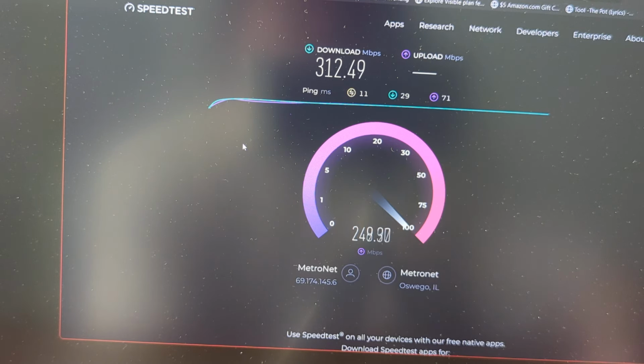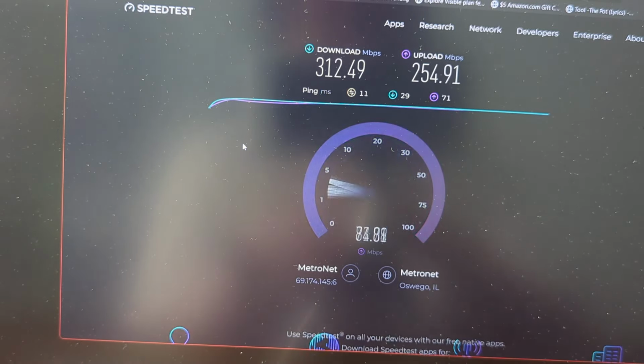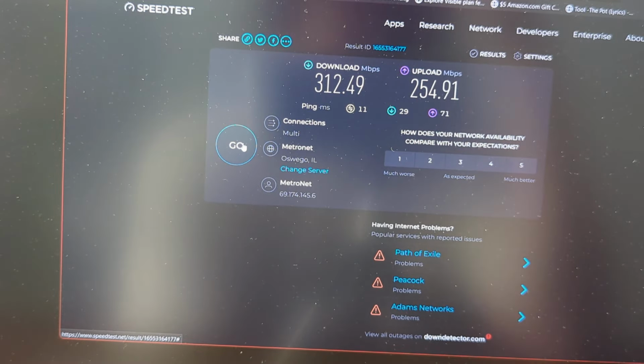And again, Wi-Fi 7 is just a perk. And I got this because I don't have any other clients that have Wi-Fi 7. My phone is a Pixel 7 Pro, which is 6E, which does occasionally connect at 6 GHz. I don't know why, but sometimes it just doesn't. I have MLO enabled on my access point. And when I do force it on 6 GHz, it's only slightly faster. It's not really worth connecting at 6 versus 5. And I only have a gigabit internet.